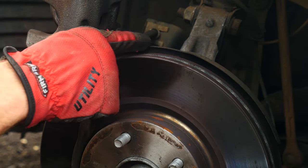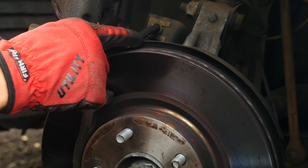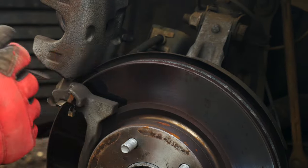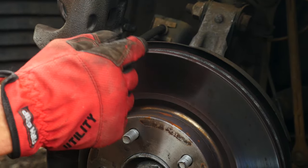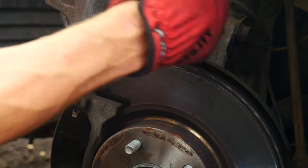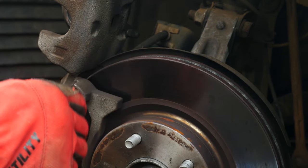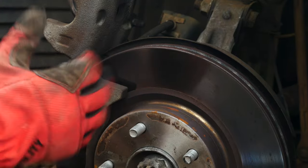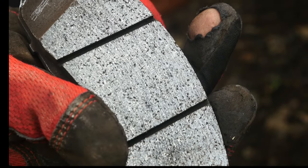The shield behind the brake can also make a scraping, squealing sound if it gets bumped or bent in and touches the rotor. It's a little more rare — usually happens when you make a mistake during your brake change and you bend it. That usually happens kind of all the time whether or not they're hot, but it's something to look for.